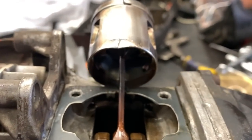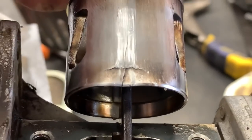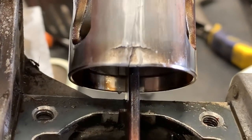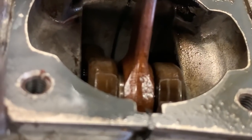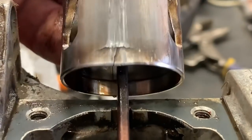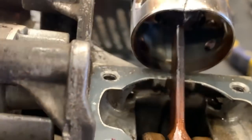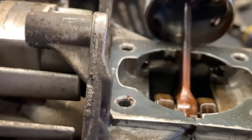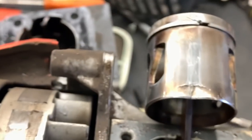Check that out — what is going on here? Something bashed that piston skirt in. Look at the piston skirt. The bearing's good, the wrist pin bearing is good. Something got in there. While this piston was on its way down, I guarantee something got in the intake port. I'm going to have to do a little more digging to figure out what in the world went wrong here.